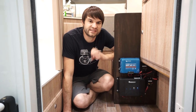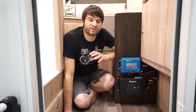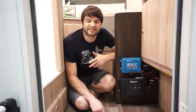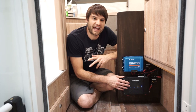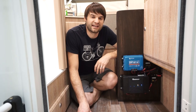A lot of people with older style batteries — the sealed acid batteries, the flooded acid batteries, the gel batteries — will just use a cable straight back from the truck into their camper's battery. Sometimes they'll use an isolator or separator to turn on and off the connection. However, with lithium batteries especially, you want to control that charge a lot more closely, and a charger like this can do that. It will basically limit the charging at 50 amps, which allows the truck alternator not to be overworked and cook itself.